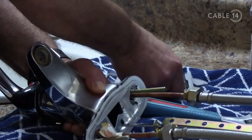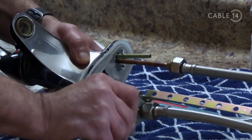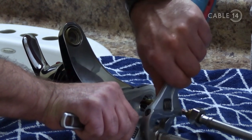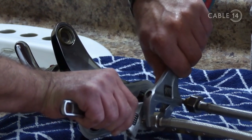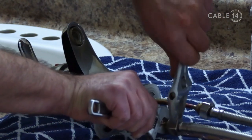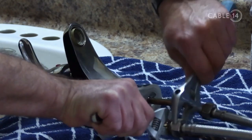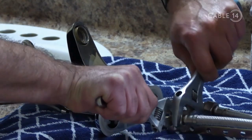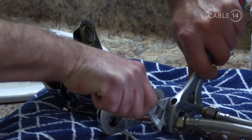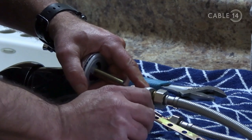So you need a backup wrench. Grab the nut nice and solid, then grab the other one — the nut that's part of the fill hose — and tighten. Constantly keep pressure on the small wrench so that you don't end up turning the copper line. Okay, that's tight. Give it one more snug. Same thing on the other one.